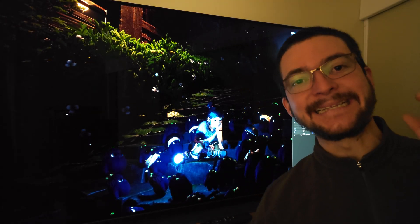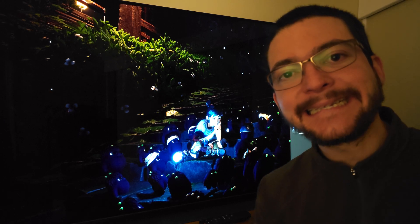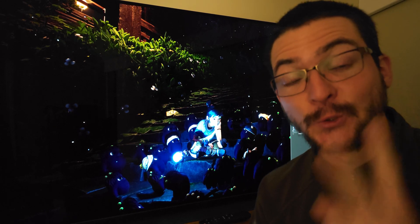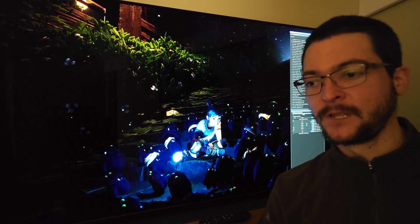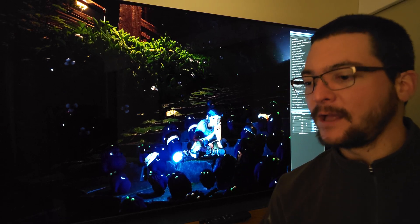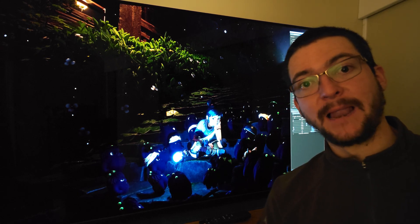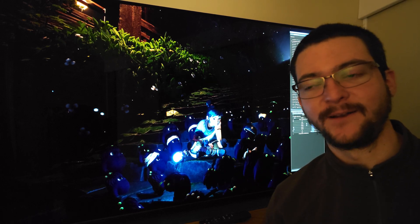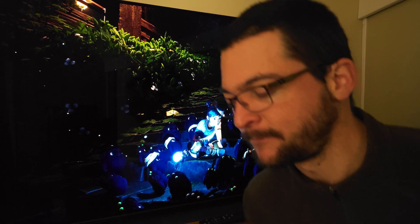I consider the settings I'm gonna share with you in this video a major breakthrough. This is how I'm gonna play most of the games you see in this LG OLED. We basically have two TVs in one — one with black frame insertion and one without it. But the problem is you turn on OLED Motion Pro and it just looks too dark. LG is not doing anything to calibrate the picture quality when you use black frame insertion, so it is very difficult to get a perfect picture. You're losing brightness, and on top of that the near black is too dark.